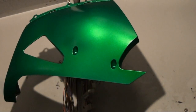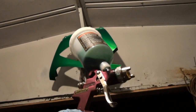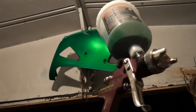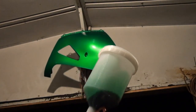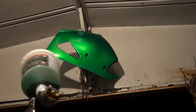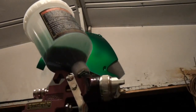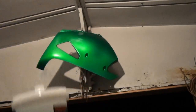This is gonna be the continuance of the review for this Harbor Freight gun, because in the other video the gun ended up leaking really bad from all over. Since I got a new one, this one seems to be working better — even though it's still leaking, it's only leaking from the cup, which is normal. I think I just left it too long and it started leaking. But if you have any leakage like this you'll want to put some Teflon tape.